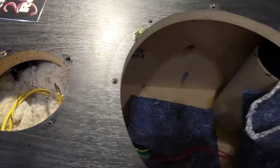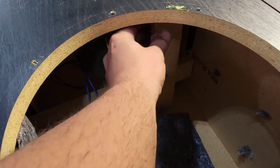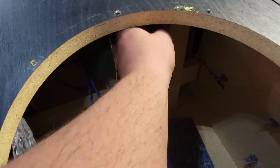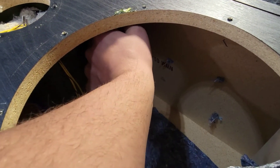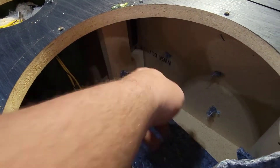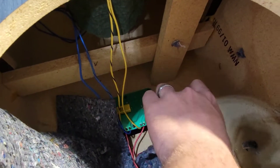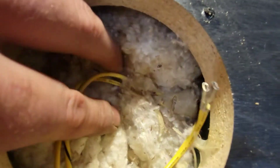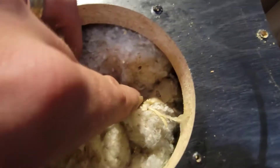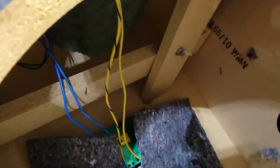So again, I was right — these are very close to the same as the VS120. This brace here has come loose and that's what's rattling around. I can feel there's still glue there; we'll have to get some glue back in on there and that's an easy fix. Looking inside, they don't give you a lot of room. Here's the crossover — it was pretty tight getting in there. Just like the VS120 they've got your baffling and insulation in there, and this piece was glued in to seal where the wires go. When I'm putting everything back together I'm going to put some caulking in there and make sure that's sealed up.